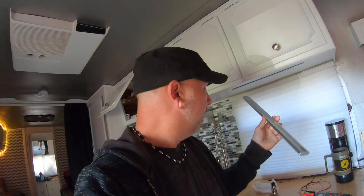Realistically, the only things I use the converter for are to power my power jack outside and to complete the 12-volt circuit for all my internal lights. Everything else running off AC works just fine, but the 12-volt lights on the ceiling and the reading lamps won't work. If I unplug the converter to avoid draining my solar system, I end up using battery-powered magnetic lights at night when boondocking.